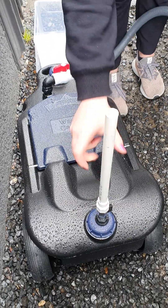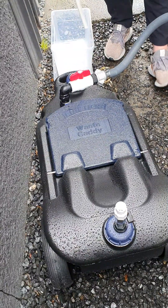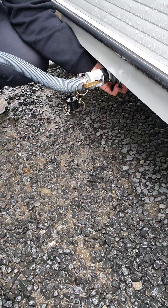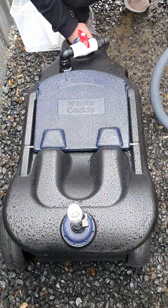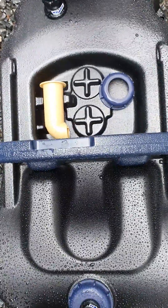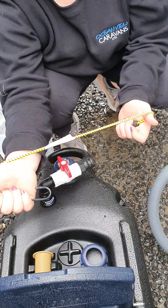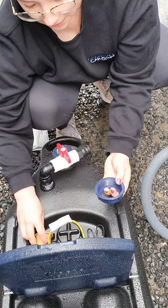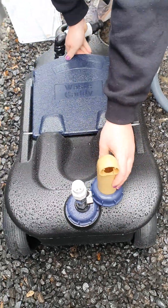At the other end is your breather — just pop that in and make sure it's open, as it lets all the air escape as your grey water caddy fills. When you go to empty the grey water caddy, take this pipe out, close that breather off, close this valve, and unhook it. Turn this valve off if you have excess grey water in the system, then wheel your caddy away to your dump station. There is a bungee cord here with eyelets on the side so you can strap your toilet cassette on and empty it at the same time. There's also a little spout on the end for directing the flow when emptying.